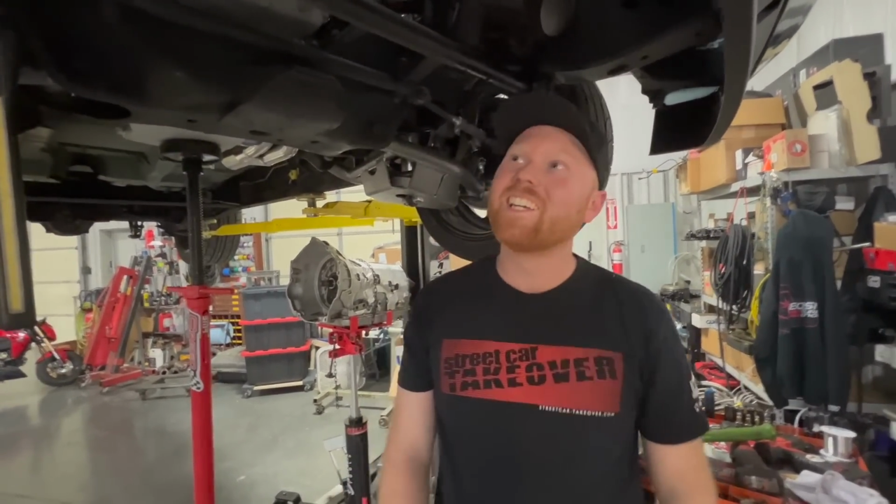Oh, yeah, you can't run the front horn with the heat exchanger. Guys, if you're doing one of these truck swaps with the heat exchanger and the supercharger like we've been doing, the stock horn location is right in the front, and the heat exchanger is right behind there. Once you start going fast, the horn will flex enough that it'll actually get into the heat exchanger. So relocate the horns on the trucks if you are running a heat exchanger.